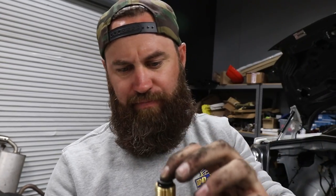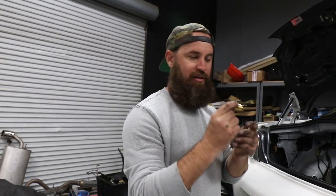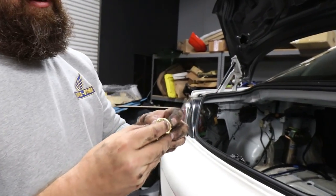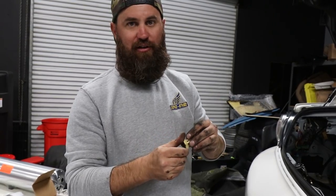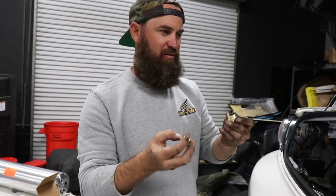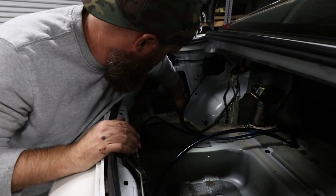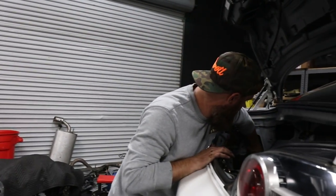These bulkheads are really sick. You just drill — I think it's a three-quarter or seven-eighth inch hole — using a Christmas tree bit until the body of the fitting just slides through. Then you have a nut on each end that snugs it up and seals it. If you're finicky, put a dab of seam sealer around the edge of the bulkheads since they're in the wheel wells where water gets splashed around.